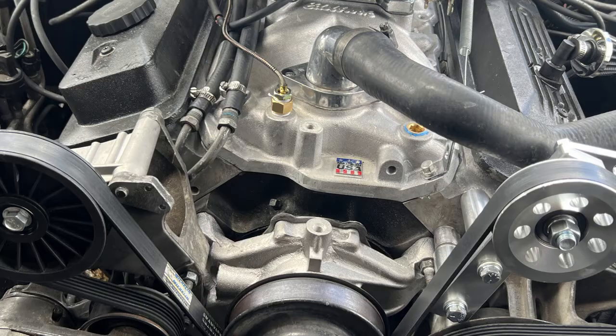After this, you have a bunch of minor stuff you need to do once you have your carburetor and intake hooked up. You'll need a bunch of threaded plugs or gauges to put in the threaded holes of your intake. Also, potential vacuum caps in case you're not going to use PCV and other things like that. The 2021 kit had all the gaskets I needed from the intake to the carburetor and anything in between that I didn't think about.